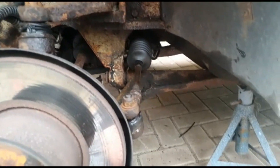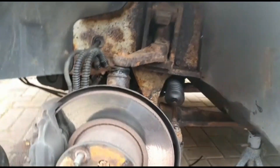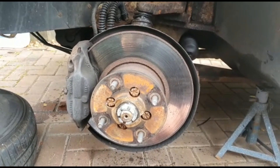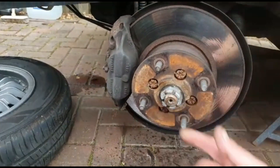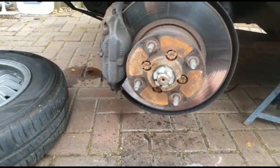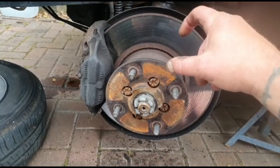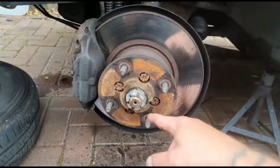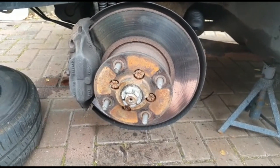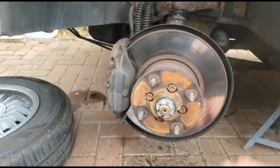That's all back together - nice and tight. Other than that gator, there was no problem with any of the ball joints, which I was quite happy about. Where the grinding noise is coming from it could be the other side - noise does travel. I'll get the wheel off the other side and do exactly the same. I've already pre-removed the split pin from the hub nut. I'm going to knock that cap out from the wheel center, put the wheel on, let her off the jack, and just check the torque on this hub nut. I don't think these are adjustable as there's a collar in between, but it might just nip up if there's a little bit of wear.